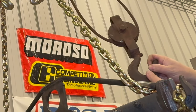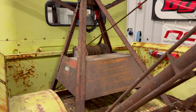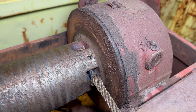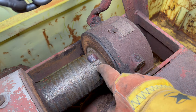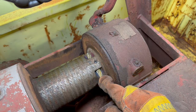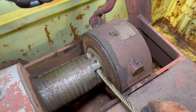This is going to come off with the cable. The normal end of the cable is up here and it's just down there now. I can spool this whole thing out and remove it. There we go — we've made it to the end. Now I need to remove that set screw so I can remove the cable. Now I can slip my new cable in and wind it up. This goes to show why you don't want to use your winch with it wound out all the way — it's going to be really weak. Its strength comes from being wound up. I just want to hold tension on the cable as I wind it up.